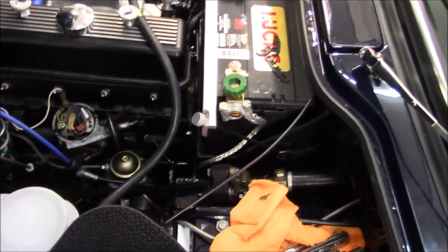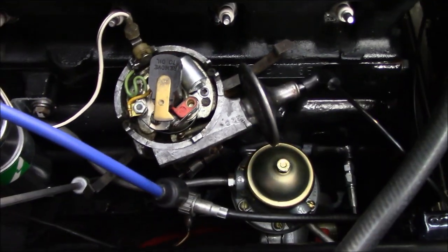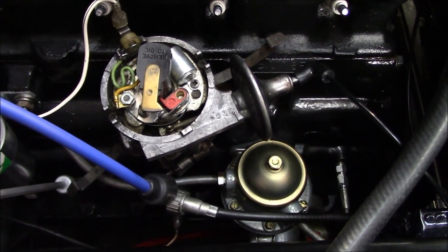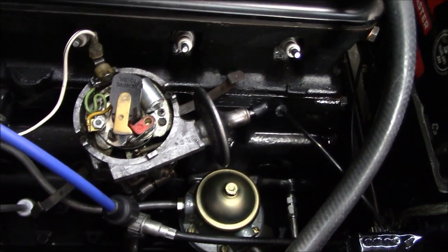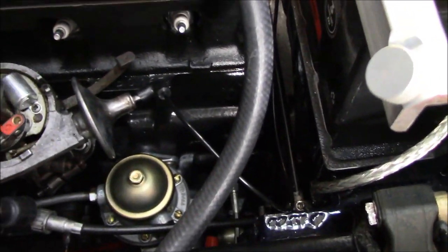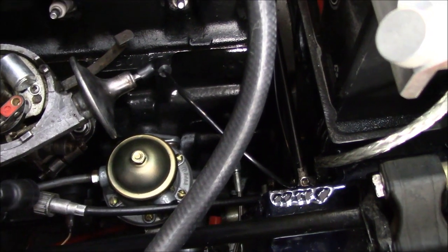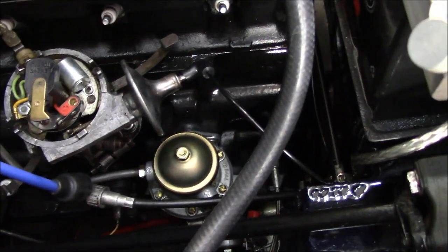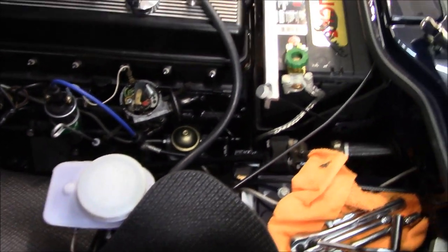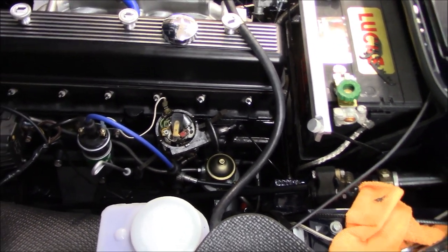We're going a little bit backwards now. The car is on TDC on the compression stroke and the rotor is pointing at just a little after six o'clock, whereas it should be pointing at about seven o'clock. The problem I'm having is with my tach cable - the way the distributor is positioned, the tach cable needs to run over the top of the fuel pump, which is causing a problem. The distributor needs to rotate out away from the engine so the tach cable can be attached properly. We're going to attempt to lift, move, and twist the distributor drive gear to make this fit a little bit better.